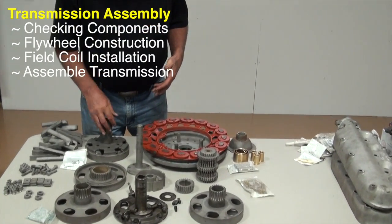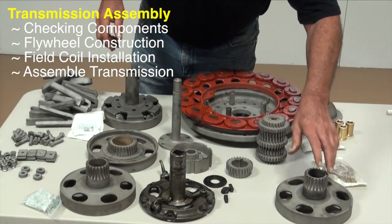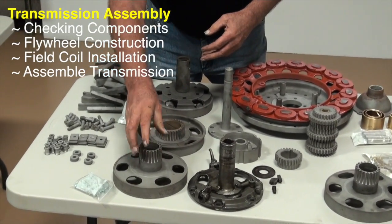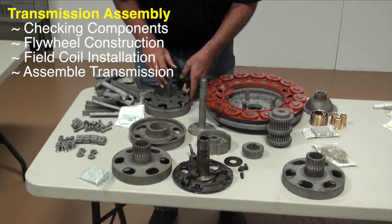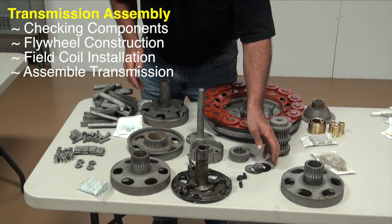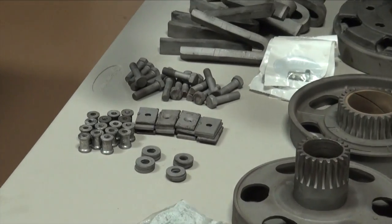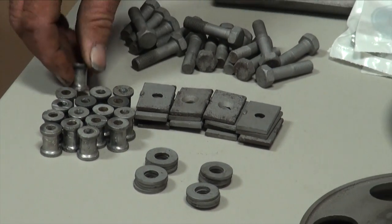You have your brake drum, reverse drum, low speed drum, a drive plate. I've got an extra brake low speed drum here. We'll look at these gear surfaces, look for cracks in the drum, and pick out the best gears that we have so we stand a chance of putting together a transmission that's quiet. We want to make sure that our surfaces are all cleaned up and ready to go — the clutch basket, the driven gear, washers for setting the clearance, all our keys, washers, spools. We want to examine and make sure they're not cracked, and I'll measure these — I'd like them all to be about the same thickness.